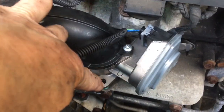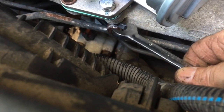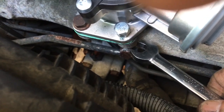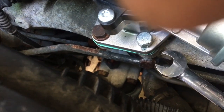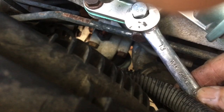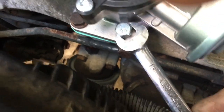My solution to the damaged thread on the manifold — this hole is open at the bottom, so corrosion built up on the original bolt and when I pulled it out it took some of the thread with it. In a workshop you'd drill it out and put a helicoil in, or put a stud in — but a stud restricts access. What I've done is put in a bolt longer than the original, gone right down to the end of the open hole, then put a nut on it and tightened that nut up. That's got it pinched — at least as tight as the original.